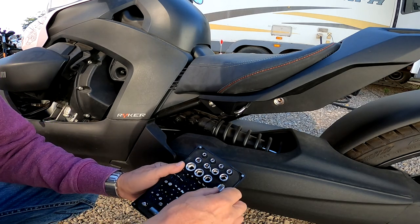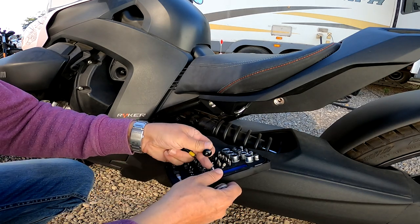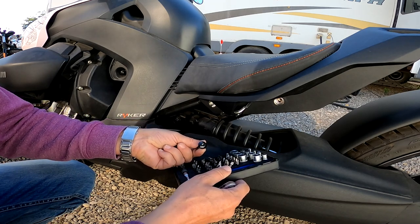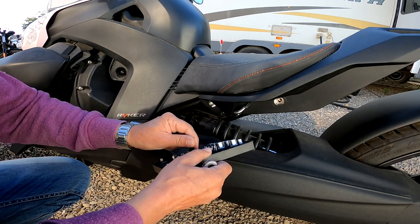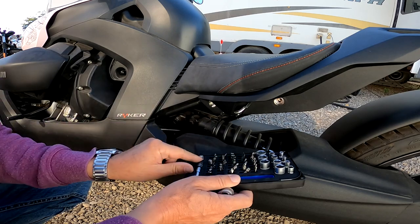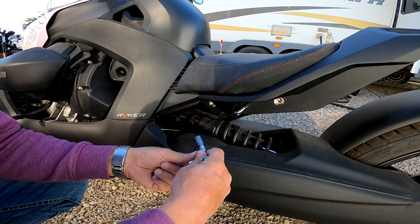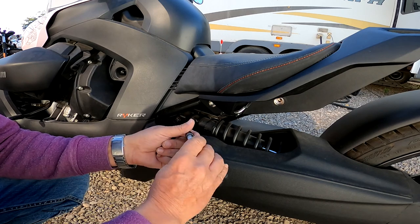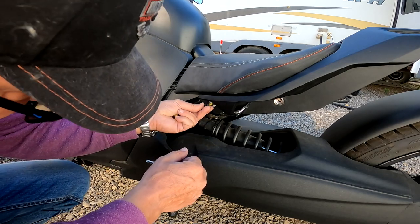And I'll just use my little socket kit here, because we need some Torx screws that fit there. What does it say? 8.8. I think it's a T40 fitting. Yep, it's the T40 screw. So we'll grab that one and then we will simply screw them in. Put a little extender on. And then we should be able to put them in here.